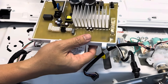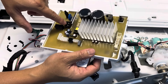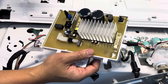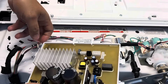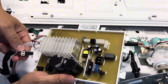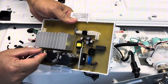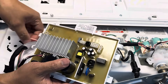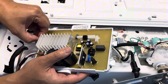Here is the new replacement control board straight from Maytag — this is an OEM part. Before I picked this one up I took my old one back and verified that all the pigtail connections are exactly the same as my old one before purchasing. The connections are made so they can only fit in one slot, so you don't have to worry about mixing up a connection.